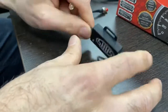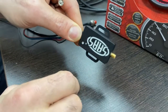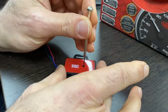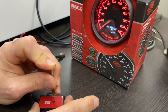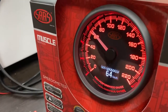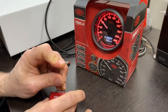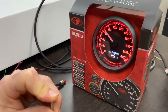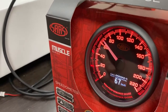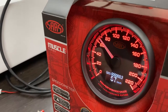You would have seen the light was just quickly flashing red. We don't need the antenna connected for this part. So I'm going to press the button and hold. Release the button — you can see it's gone just past 60. We want it on 60, so I'm going to press the button again and watch where the needle goes. The needle's going up — we don't want it to go up. Holding the button will just continue to move the speedo towards maximum speed.